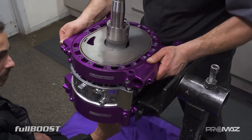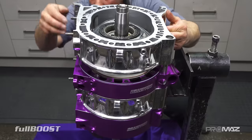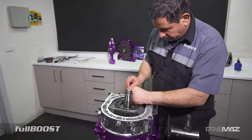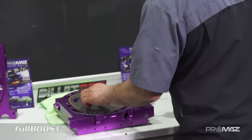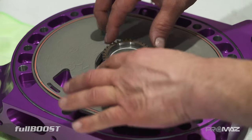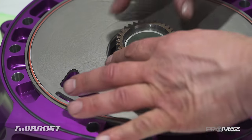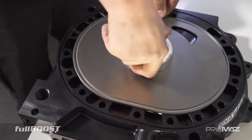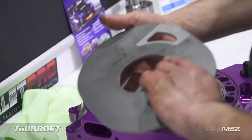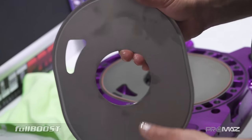Here's the way the insert is held in — it's got a single nut that tightens the insert in, evenly in the middle. You'll see a lot of billet plates with screws all over them, but we like these because they actually torque down the centre to 100 Newton metres and clamp it down evenly. When you see it apart and being put in, you realise it can't come out — that's where the threaded nut goes in to hold it.